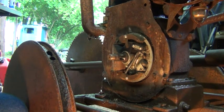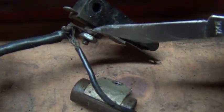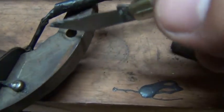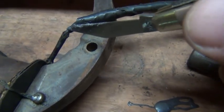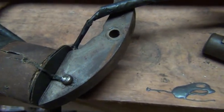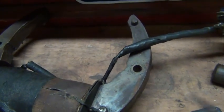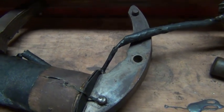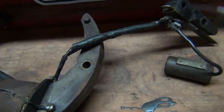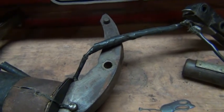I bet she should fire. I went ahead and pulled the mag right off - this is kind of easier to work on a bench. You can see the wire for the condenser is only held on by about two or three strands. The low-tension wire is broken right here, and it's real loose down at the coil too. I'm really hoping I can save this - these are kind of hard to come by and pretty pricey when you do find them. Worst case, I can always run it on a total loss system, just run off the points and a 12-volt coil. I'm going to go ahead and get the points cleaned up and this wire fixed - I'm going to cut it out from here down and replace that wire.